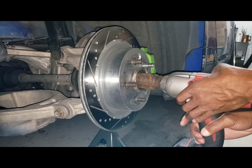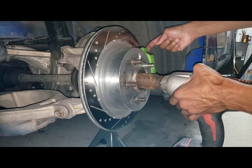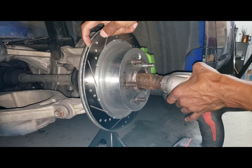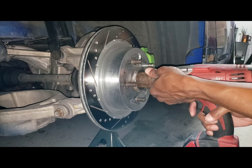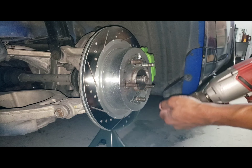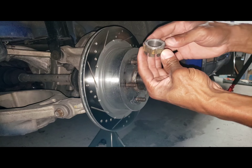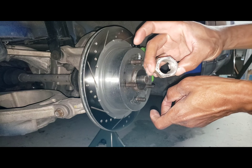A lot of times if you have to break an axle loose, you can shove a screwdriver in between the caliper and the rotor, because it has these little fins in between here. If you can get a screwdriver to stick in between there and jam it, then it'll lock it all. I know that there's enough resistance on this that it'll just rip apart - just like that. Real easy. I've been in there before and there's anti-seize on there.